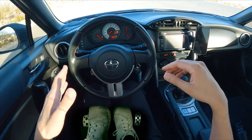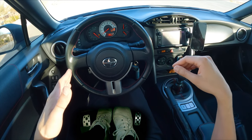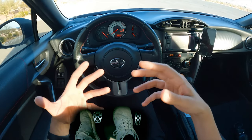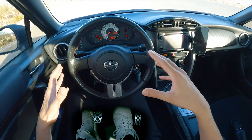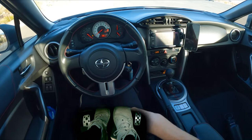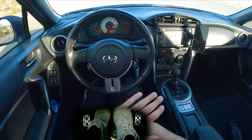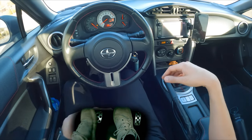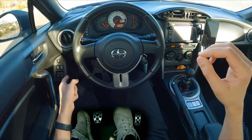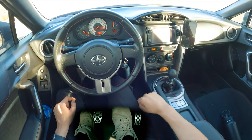Technically, if you have your left foot on the clutch the whole time, the car is running and everything's fine, but this is bad for the throwout bearing — it's wear and tear on the car. It's a bad habit. Sometimes people will stop at a red light like this — we call this riding the clutch — they're in first gear, holding the foot on the clutch. Not good, so don't get in that habit. I want you to reset fully: left foot off the clutch, right foot on the brake, gear selector in neutral — those three things.